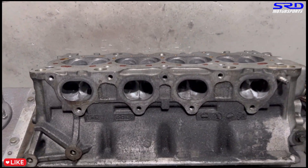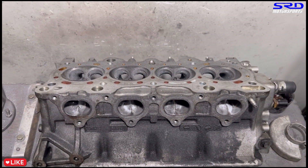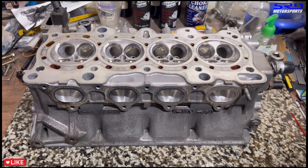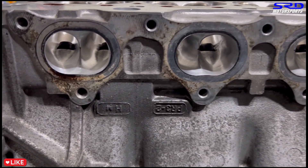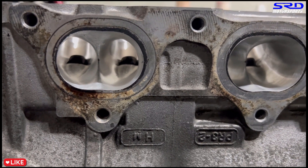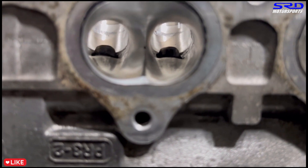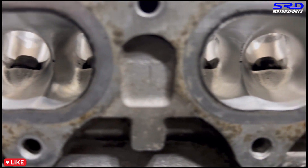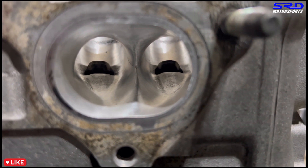It's almost getting there. We're going to make a few more passes including the chamber, then clean it up and show it on the workbench. After washing, it's cleaned up but not yet finished - it needs a few more touches. The exhaust port is starting to look really good. You can see the core shift by the bowl is still there. We didn't remove that because it would twist the port and make the shape not ideal for performance, so we just leave it.